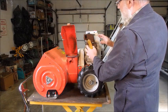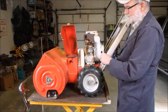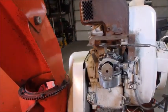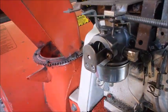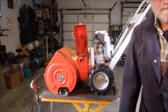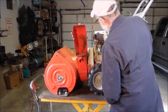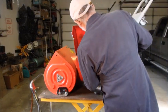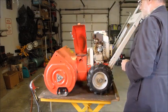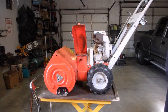So that box just heats the air around the carburetor to help it run a little bit better. And these don't have an air filter — did you guys know that? Most snowblowers, because the air is pretty clean, snowblowers don't have an air filter. So our friends down in Texas and in the south that don't work on snowblowers a lot, that's probably a surprise for you. So it looks like we're going to have to take off the carburetor and maybe not the muffler, but the carburetor, to get at this valve door.